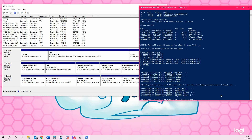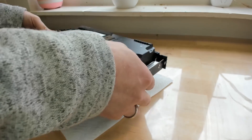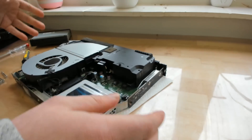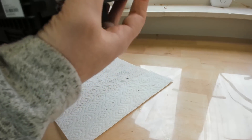This might take some hours. After the script finished, I made sure everything works by hooking up the SSD and connecting the stripped Xbox to the TV. At first I thought it failed, but I forgot to install the OSU1 update that is required after every disk swap. This update can be downloaded from the official Xbox website, and I'll put a link to it in the description.